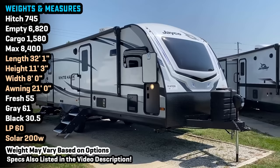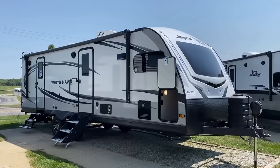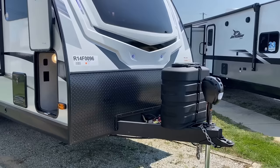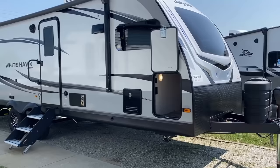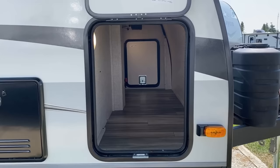Towing recommendation: you look at the empty weight and think a half-ton could handle it, with the wide stance axles helping. But having a full living room super slide in front of the axles creates a pretty hefty hitch weight. My generalized recommendation is a three-quarter-ton pickup. If you have a very hefty payload half-ton and you're not going far through mountains, maybe you could manage for local towing. They're still doing 30-pound propane tanks, which is becoming a rarity — having that extra propane capacity is nice because this is cold-camp rated, and cold camping will murder your propane reserve, so having more time between swaps and the ability to shop propane prices certainly doesn't hurt.